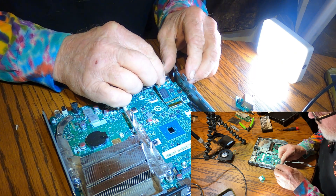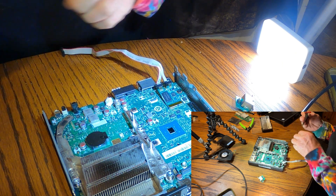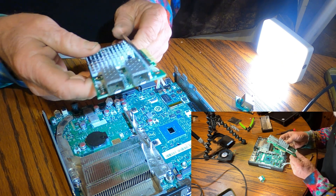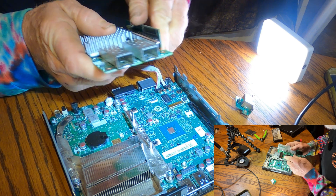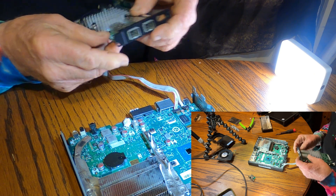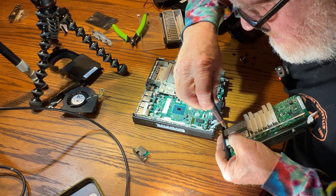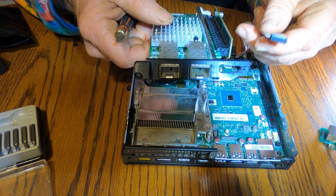The next thing I want to do is install this 2.5 gig M.2 A+E keyed NIC — it's going to be the WAN port for my router. I bought one with a Realtek chip because I'm cheap. Next thing is to add this dual 10 gig SFP+ card — this is an Intel X520 DA2. Untrusted Source also sent this bracket for it. These little pointed screws made to go into plastic are going to work best. This plate came with vent holes but I modified it so I could fit the network card through there.